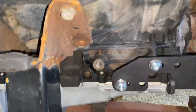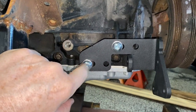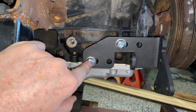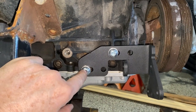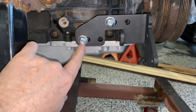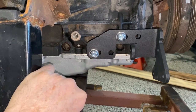The lower bracket is now on. One thing I noticed in drilling this hole is that you have to hit it exactly in the center, because this bracket is made just exactly so. My hole was slightly off to the left, so I just used a round file to open that hole up so that it would allow this to line up correctly. I followed the directions and tapped it half inch deep, but the shortest screw was still a little bit long, so I simply used a couple of extra washers — four washers instead of one — because I didn't want to risk drilling deeper or getting through the block.